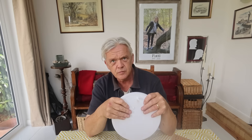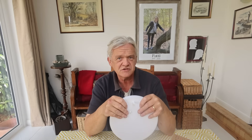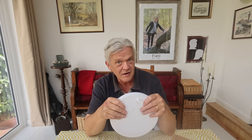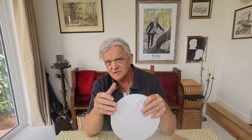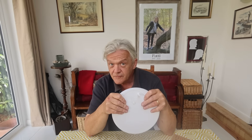Now there is an issue with 3D printing in terms of accuracy. We need it to be absolutely accurate. So doing something like this with gears — because gears have backlash — it can lead to errors of accuracy. And I decided that one way to go might be with the friction drive.